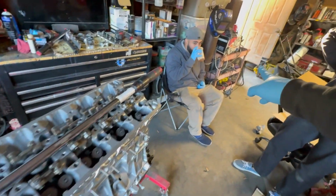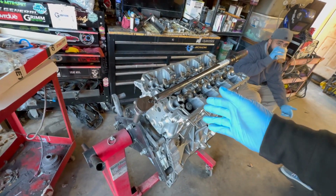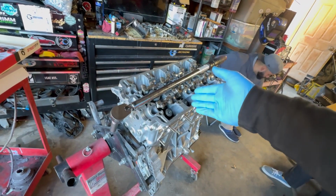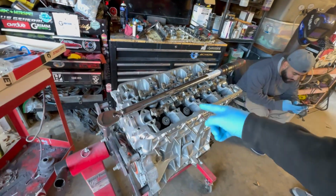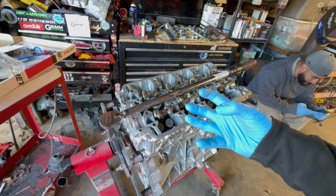22. And then what's it go to? 60? 60. So 22 to 60. With ARP and OEM, this is what you always see in those videos where people tighten down the bolts and then you'll see them go BAM! And they'll kind of look at each other like, what just happened? You're literally supposed to let them chill after you tighten them down because they seat.